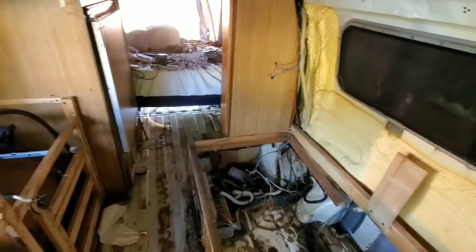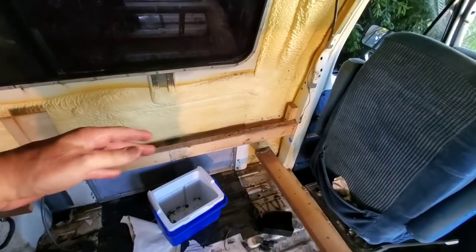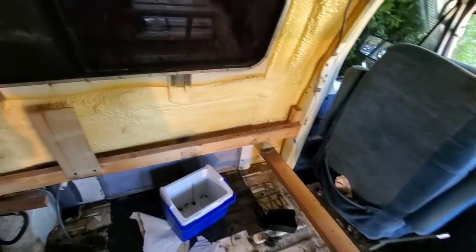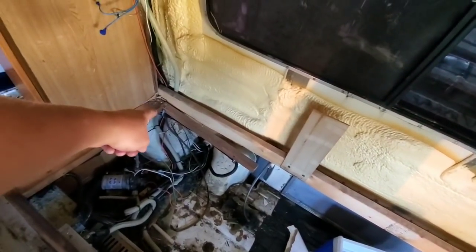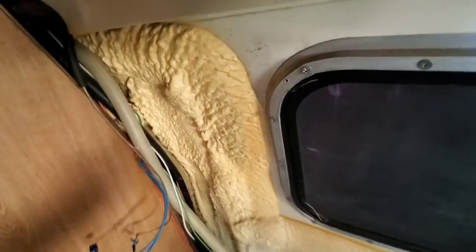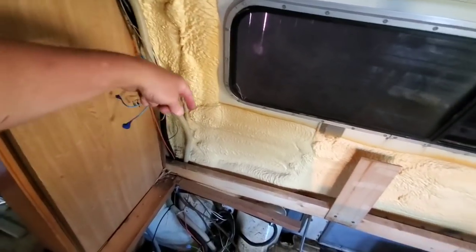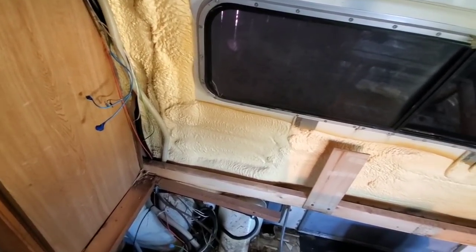Some of it has to be sheathed, some of it can just be run. But the big issue is attaching — we want to have a backer for the table here, where the tabletop sits down on two pocket slots on this side and the leg comes out here. We only have one point of strength in this whole side, and that's resting on the wheel well back here, this 2x4, frame bolted. Now we need to run an upper one across here and tie in some vertical member to notch in behind here. We're going to have to notch a 2x4 so it's a really tight fit up in that area, hopefully getting it down behind here and resting on the floor for good support.